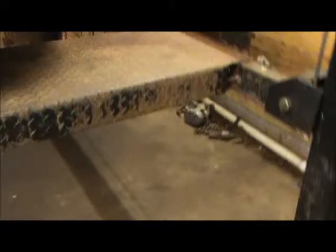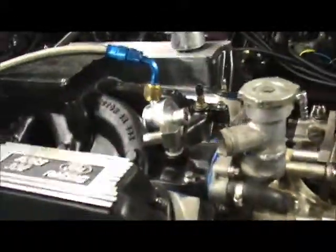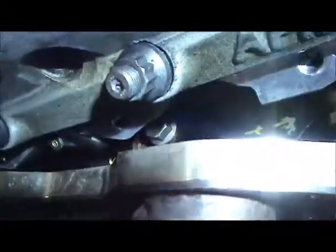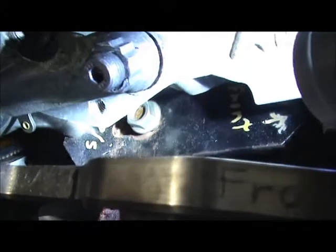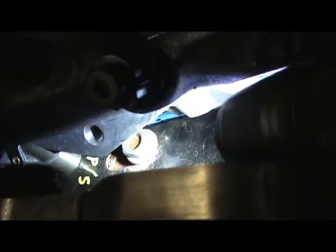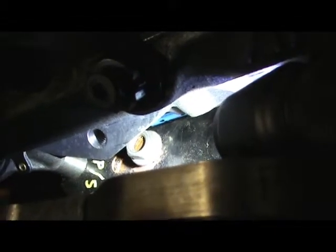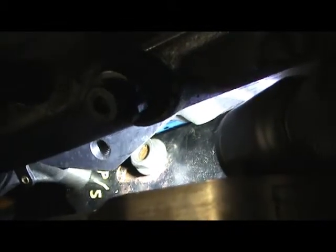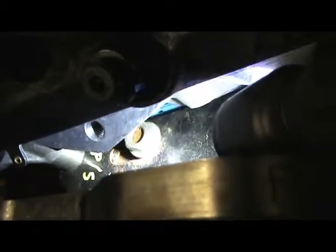Okay, I'm back. I kind of want to show you what I'm talking about with the motor mounts. You see that bolt? See, there's a rusty spot on that motor mount. So I gotta slide that motor where it needs to be to be in line with the rust mark that the bolt made all those years. So that's where I know it has to line up.